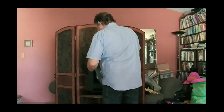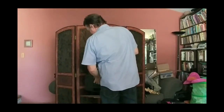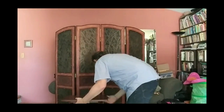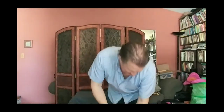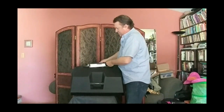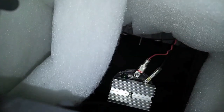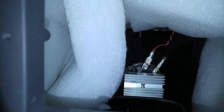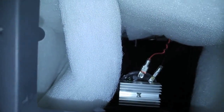I'm going to lay this speaker down on its front with some cloth underneath so I won't scratch anything. Much easier to work on now that the screws are out. There is our tweeter and the heat sink, and there's some cushioning in here. This hooks up to a digital amplifier, which is part of the reason the case is so light — it doesn't have giant magnets. There's not a big magnet on the woofer and almost no magnet at all on the tweeter, but they put a heat sink on there because these tweeters get hot, and when they get hot they burn out.